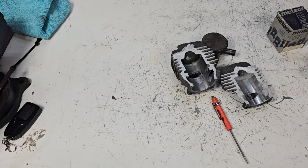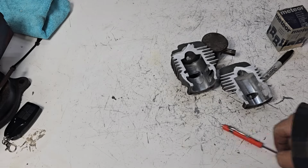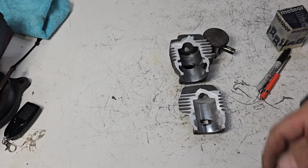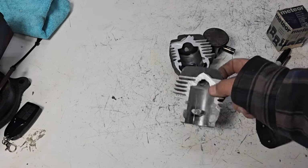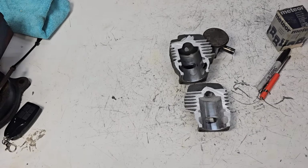On intakes, a saw like this, you don't want to run it more than 156, 158. Stock, I think these are at like high 140s, so you could lower the cylinder probably 5 degrees, which is 10 degrees of duration, and you won't have any issues. You'll just have a saw that gets more fuel. But there you go. I hope that helps, Doug.